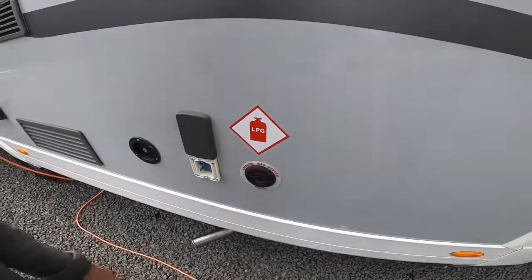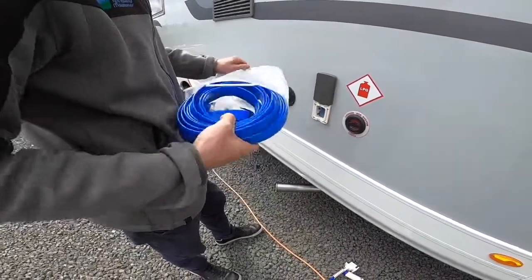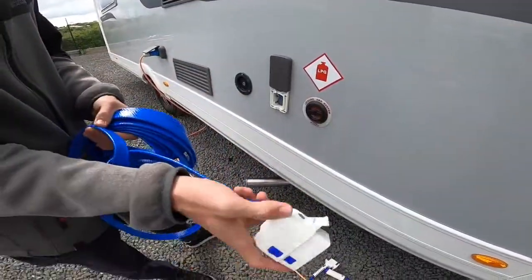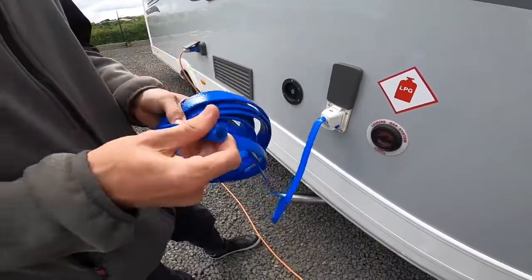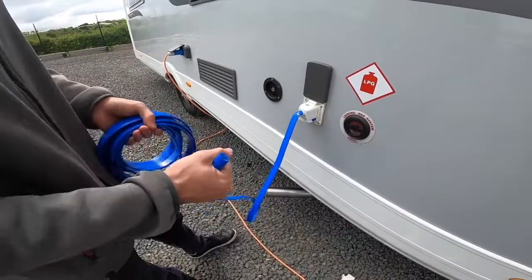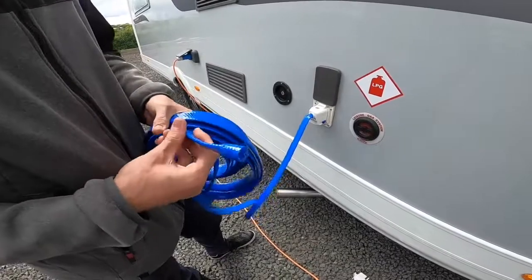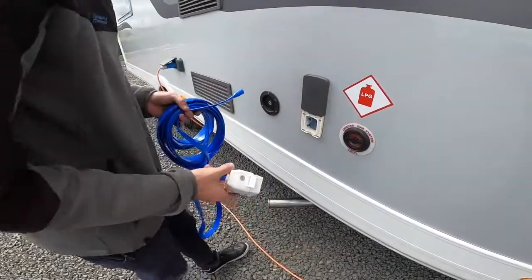To fill with water you've got two ways. The most common way with a motorhome is the hose method. You put your fitting on — the square fitting which goes on to the van — then on the flat end of the hose you'd put a hose pipe connector and connect it to the tap. You'll need the screw-on end because it's just a brass tap on most sites. That's how you'd fill up if you're going on and off a site or if you're on a super pitch.